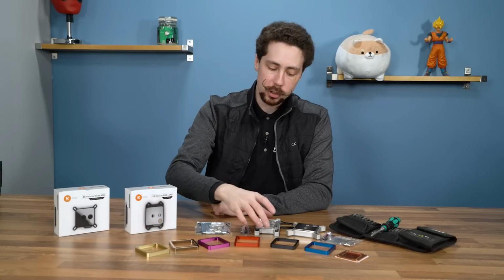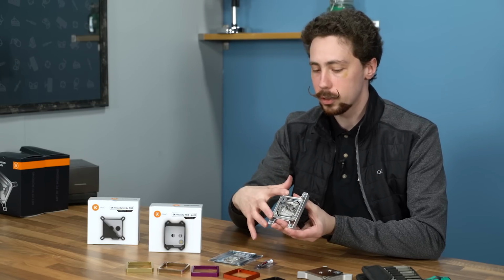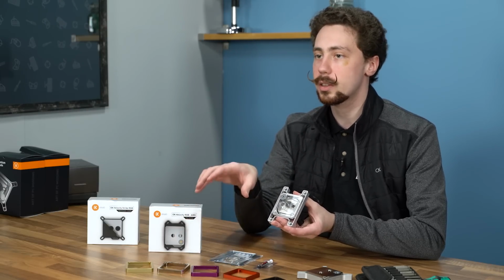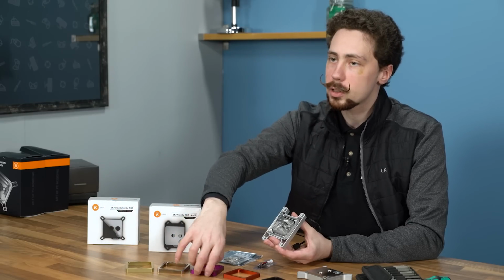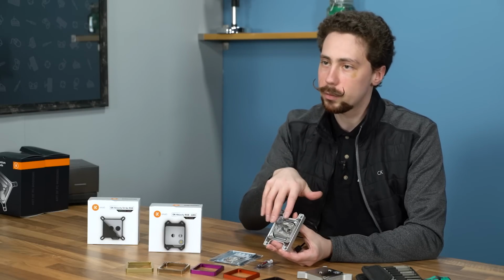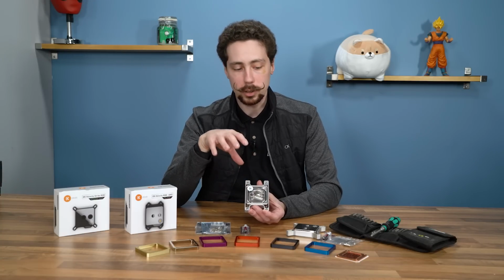These parts are all interchangeable. So if we take a look at the acrylic top one for the AM4 block that we've got here, you can see there's an accent piece that sits underneath the acrylic on the top here. And this does not come into contact with the fluid itself. So don't worry about these being aluminium. They don't touch any of the coolant. They're just there for aesthetic purposes. And you can buy these particular separate kits. I believe they're about £25, €25, that sort of realm. And you can interchange them however you wish. The stock ones come in these configurations. And then you can also swap out other parts too. So we're going to be taking one of these blocks apart, and I'll show you exactly that when we take a look at the performance.